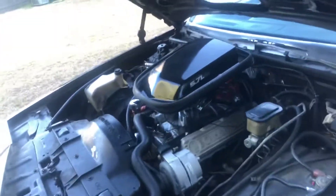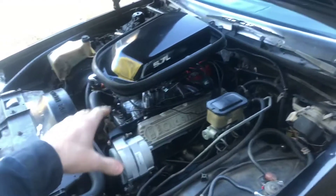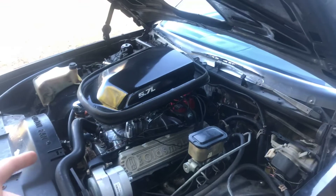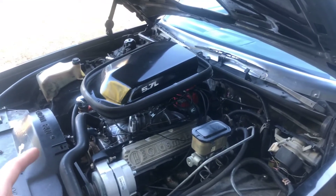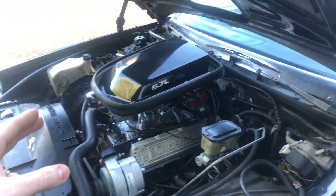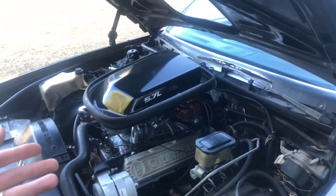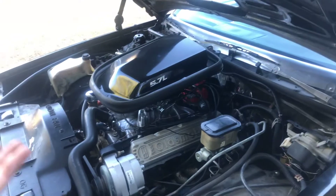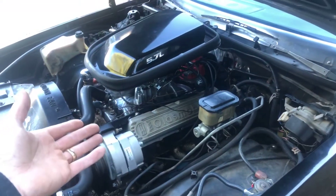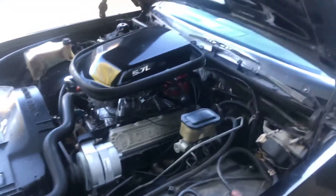Within the last two weeks, I put a new intake gasket on it and all new gaskets on the top end. I installed a Quick Fuel Holley 600 carburetor, because that's what my brother has on the '69 Corvette and it's got about the same build specs as this motor, and it runs great. I don't think the motor was big enough to handle a 750 to its full potential, so I stepped it down to a 600 and it seems to handle fine.